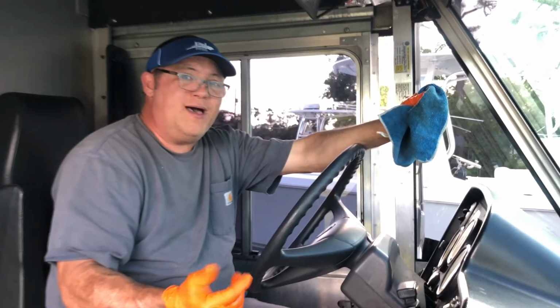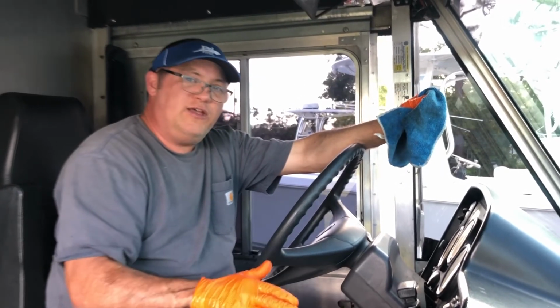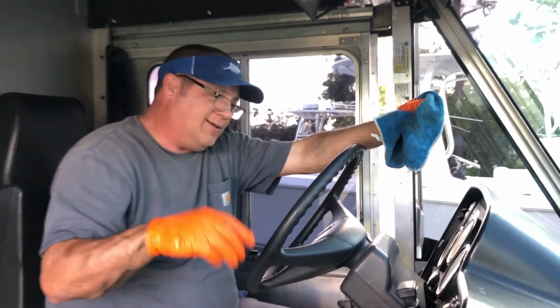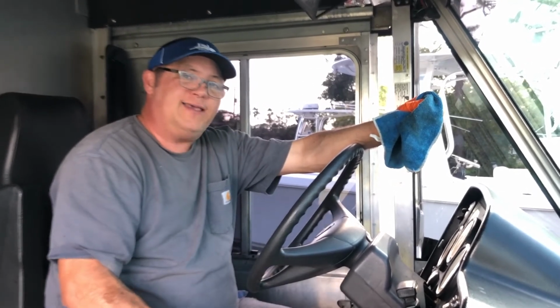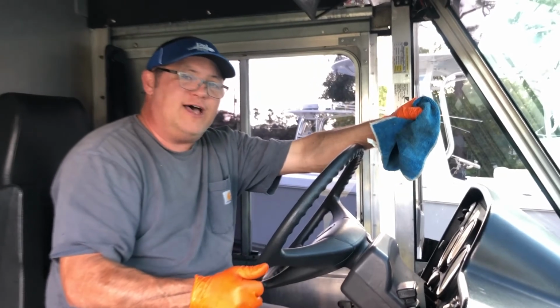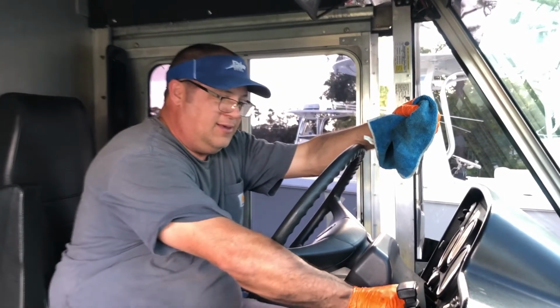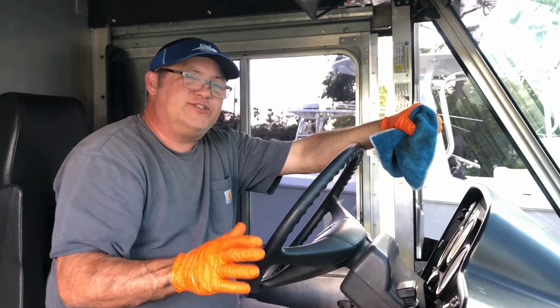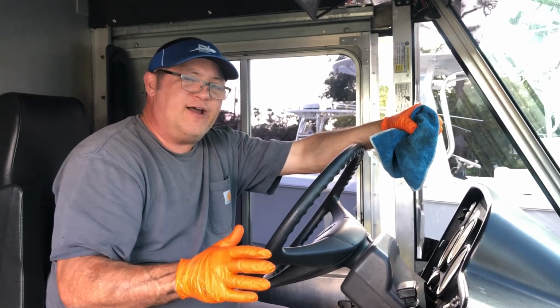Oil pressure came up. We're good. Notice the motor started right up. It didn't have to be primed up or anything like that. Just put the fuel filter on dry, and let the key cycle long enough.